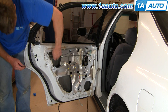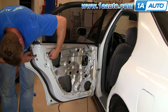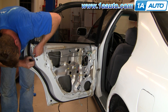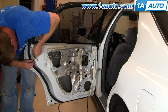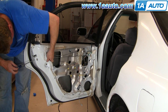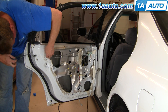I have three bolts here for my latch. I'll lift it into place here. There's a little lever that comes through here — your little child safety lever. Get that in place. If you tighten up — not all the way, but tighten up the lower one some — that way you can get your upper one and they'll bite.